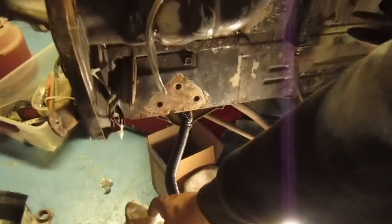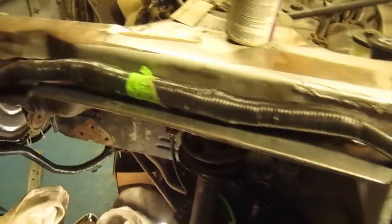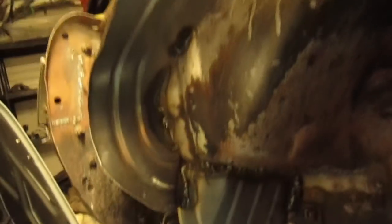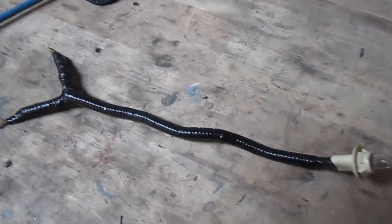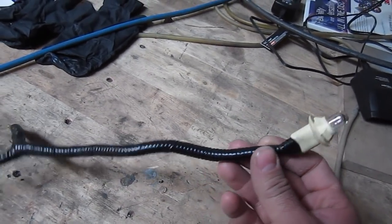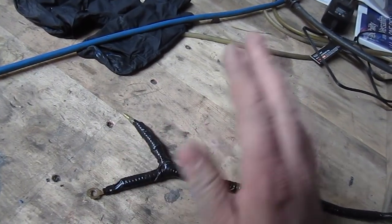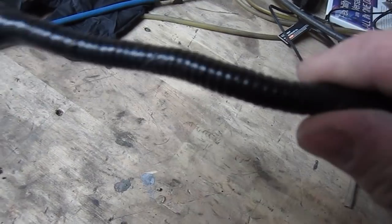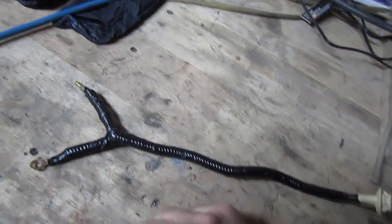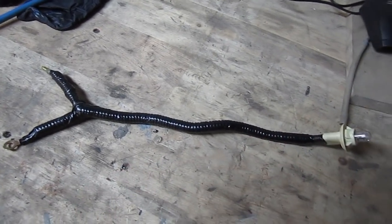We'll just pull this wiring harness up around here and it'll just sit on here like this. Now this little bit of cover kind of continues down here. This is the Camaro marker light — the actual wiring and light part of it. The light for this system requires a power and a ground, so they split off — that's why there's two wires in there. What I've done is put split tubing over it and then electrical tape over that. That is the goal for all the wiring in this car: neat and tidy. Let's go throw that back in the car.